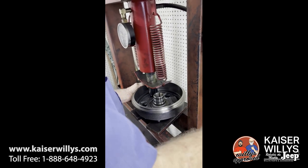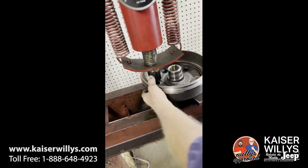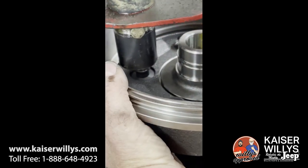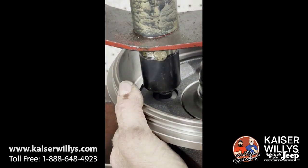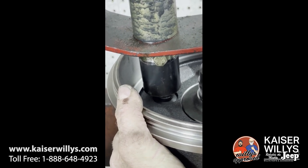It's very important that you go through the hub and the drum at the exact same time, because if you don't and you try to do the drum only, you're going to blow a hole in the drum and it's going to be a mess. You have to give it plenty of backing and drive it through both the hub and the drum uniformly at the same time until it's seated properly.